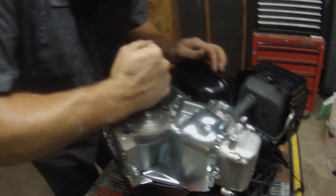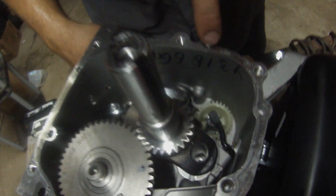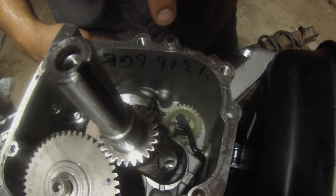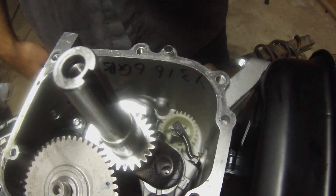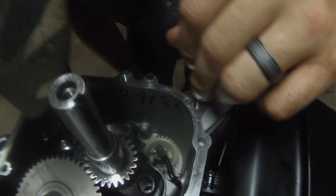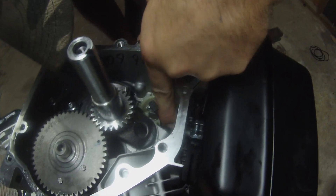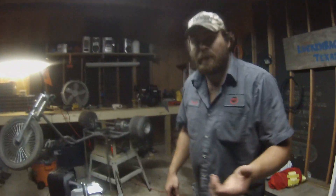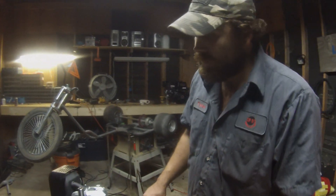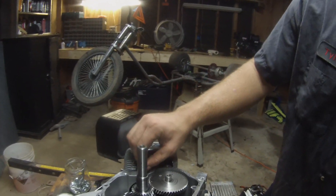Turn the crankshaft to line it up where you can see right down here. That little plastic clear gear down there is the governor — we're taking that out, we're going to take all that out. Do you know how to take that out? Yeah, I know how to take that out. Very important — we actually dropped one and found it by happenstance. Do not lose these little dowels. They come out really easy, there's two of them.